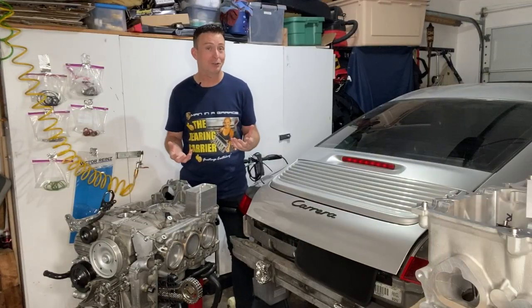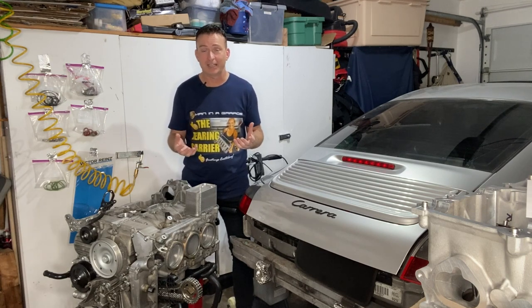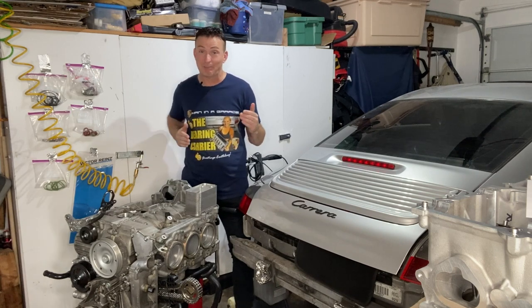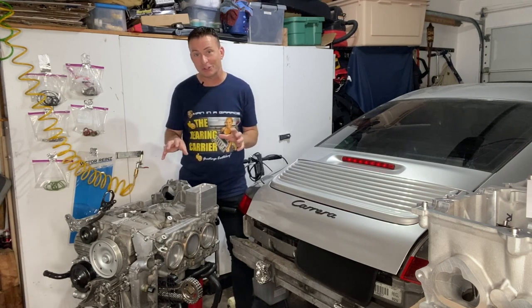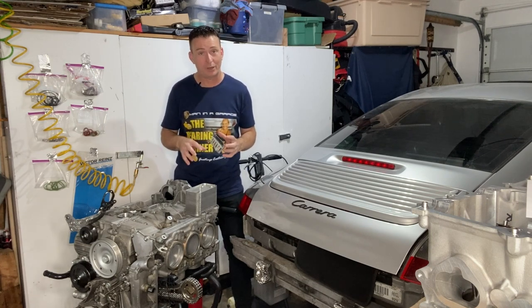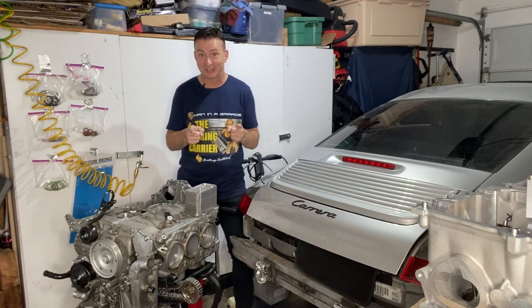Imagine, if you will, for a moment, that you are near the beginning of your journey. You've been idling through town, stopped at a couple of stoplights, and finally you're at the freeway stoplight and you give it the beans all the way onto the freeway. What that's going to do is create more explosions from your higher RPM. That's going to create more heat, and then that heat is going to have to get taken away by your cooling system. And we're going to call that sudden burst of heat a heat pulse.